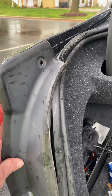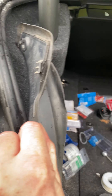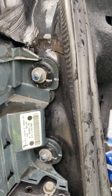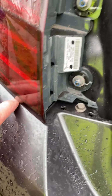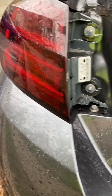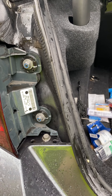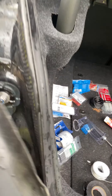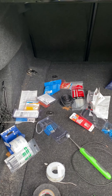If you didn't know the basics: first, there's going to be a little cover in the trunk. You're going to take that off — there's a little plastic screw right here. Work it back; there's a clip here, you don't want to break it, so just pull it back and slide it right off. Then you've got these two 10 millimeter bolts. Grab it from right here and wiggle it back and forth. You might want to tape up your edges if you're not very careful, because you can scratch your paint. But if you're really careful, you don't have to worry about it. Just put those bolts back in, slide this back in under this lip here, and screw it back in.